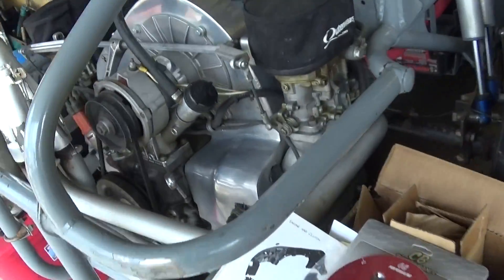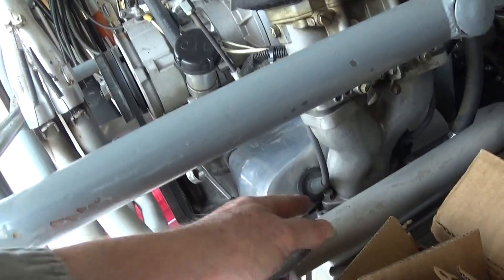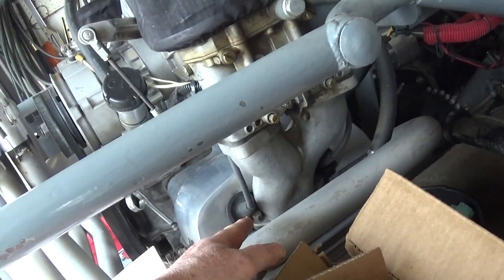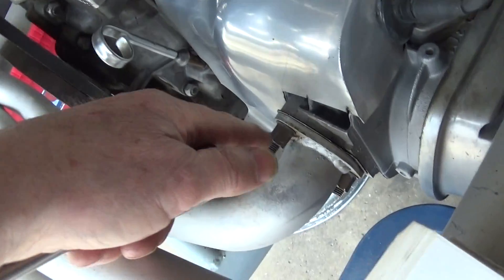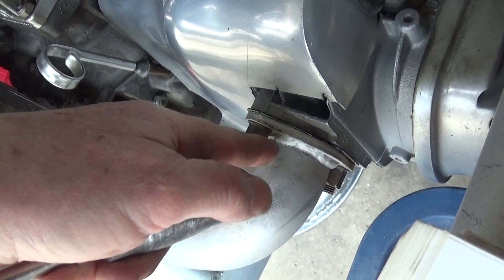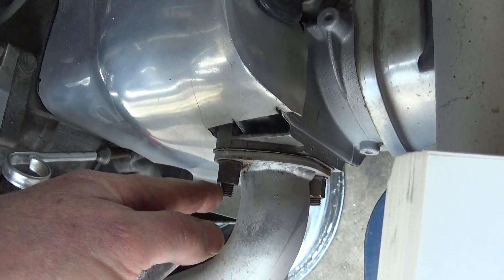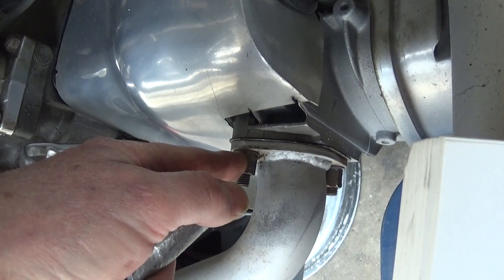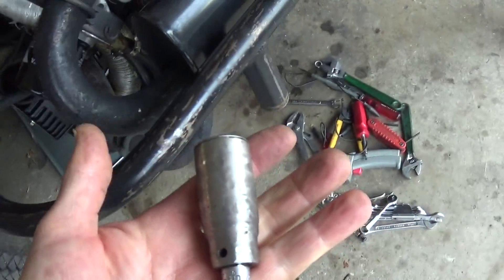Here's another example of a car that's tight. Even though it's an 8mm stud, I use those 11mm wrench-size nuts that typically come for the large-diameter headers. You can't get a wrench on the thing, sometimes you can't get them to turn, and you can see how it's close to the weld. So I just buy extra steel exhaust nuts and use them on my carburetor manifolds so I have more clearance.